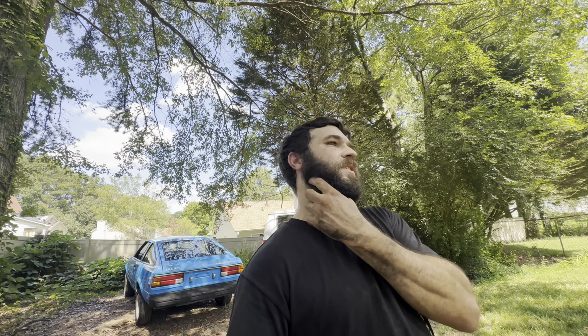The 6.7. You can get one out of an AE86 GTS and it'll bolt into these earlier cars that have the four link. Perfect bolt in, better gear ratios, rear disc brakes, and limited slip. The AE86 diffs from 84 to 85 are Zexel early axles. They use a different axle shaft and they use a different limited slip differential. The late is marginally stronger. The early is identical to all the 6.7s that came in Celicas and stuff like that.